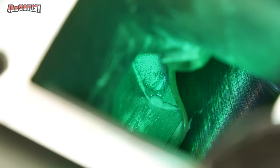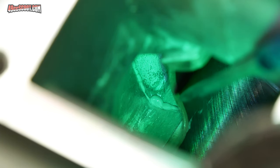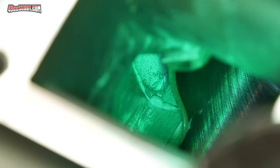Now that that's secure and I can pause for a second, you're looking into the reeds again down at the transfers. And remember, I said you'd have to be really careful because the gasket stuff could seep over the edges very easily and create more of a mismatch than any of the differences in my port matching. So if you look down there, you can see there's actually a big glob, and I think you could probably tell in the video I was as minimal as you could be really when you're using sealant,